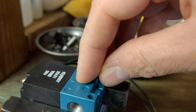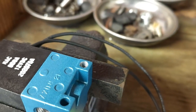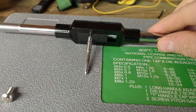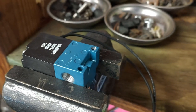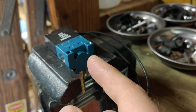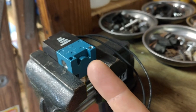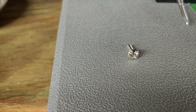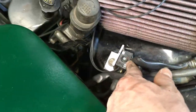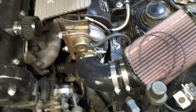We're going to run a hole through a little bracket I've created. These are the little holes where we'll mount our solenoid. For easy mounting, you may want to just tap out an M4 machine screw thread into here — I've got my M4 tap right here. That way you can screw it in from behind the bracket rather than dealing with an awkward internal cap head. It's easier to just use a standard machine screw like this. Alright, so that's mounted.